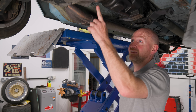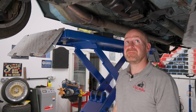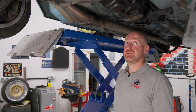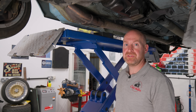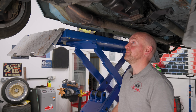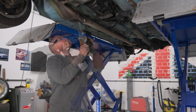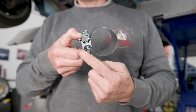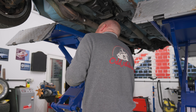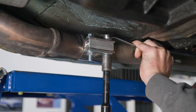Under here is really dirty, so while I'm under here I'll get hot water and a sponge and go front to back to try and get some of this grime off - the paint looks good underneath but it needs doing. With the exhaust I pushed it into place, gave it two tacks of weld both sides, ground those welds down, then realised it's just going to leak and sound awful. So I remembered I've got these stainless exhaust clamps from the Corsa turbo order for Dream Car Giveaways - they're side-fixing which keeps ground clearance good. Fitted that on - jobs a good one and that's another one ticked off.